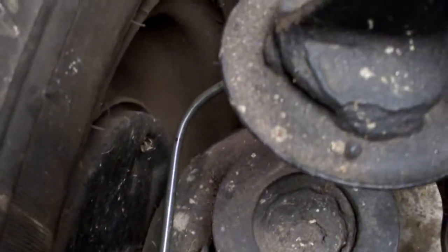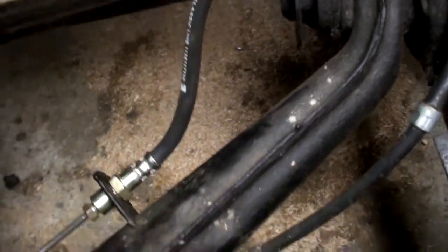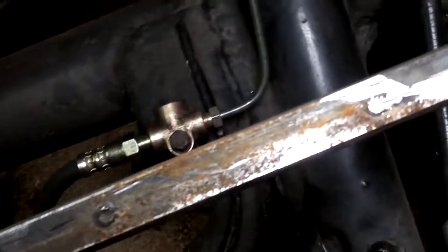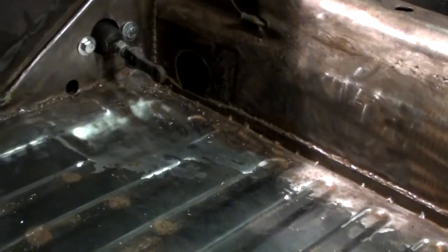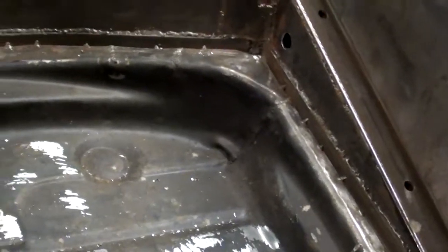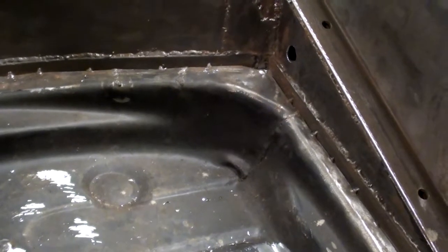This is pretty frustrating - one of the more tedious things I've had to do so far. That line doesn't look too bad; I used a wire to make a template. This one looks like crap, but it's going to work. I realized that the line coming from the master cylinder to the rear T-junction and then to each wheel has to kind of go around the pedal cluster and then along the tunnel. I think once I get it in I'm going to have to feed it in and bend it as I go, and my concern is I won't be able to take it apart.